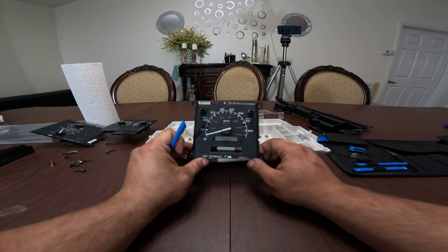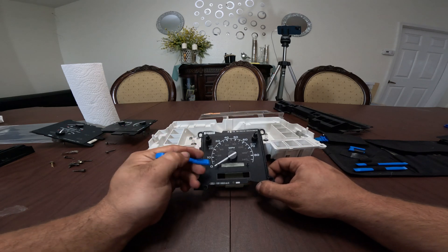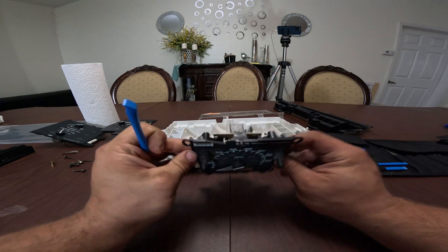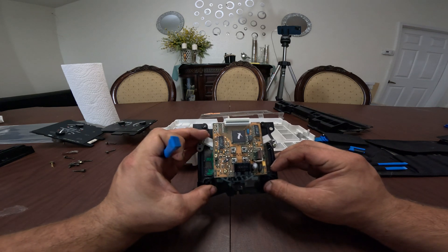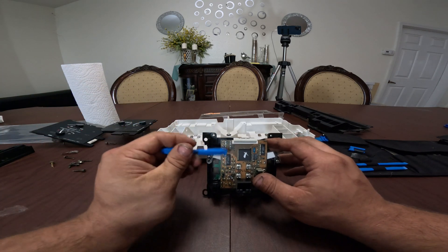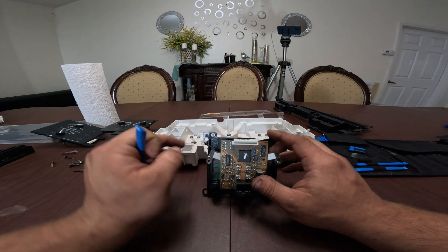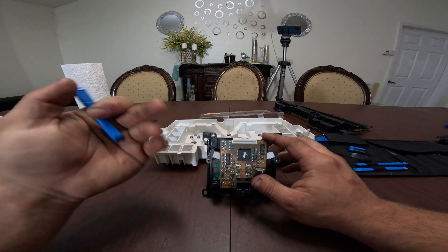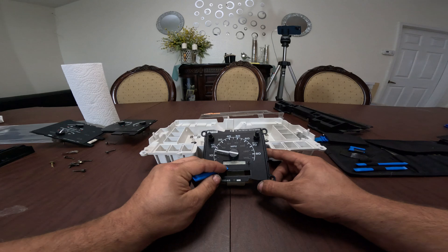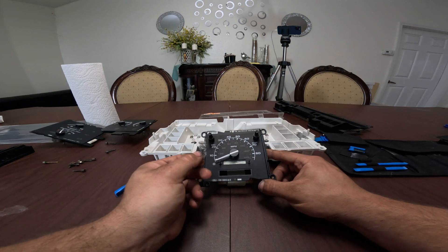The one we're most interested in is the PSOM — that's what Ford calls it — along with your speedometer. This keeps your mileage stored on the motherboard, not in the ECU. If your car predates OBD2, this in conjunction with the ECU sets the shift points by reading the tire speed via the vehicle speed sensor and rear differential. The problem is this display delaminates and leaves the polarization layer affected.